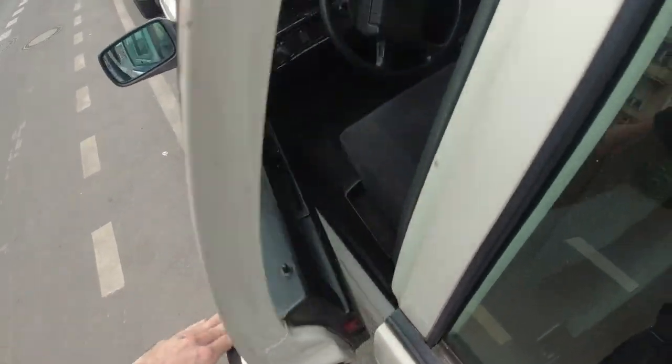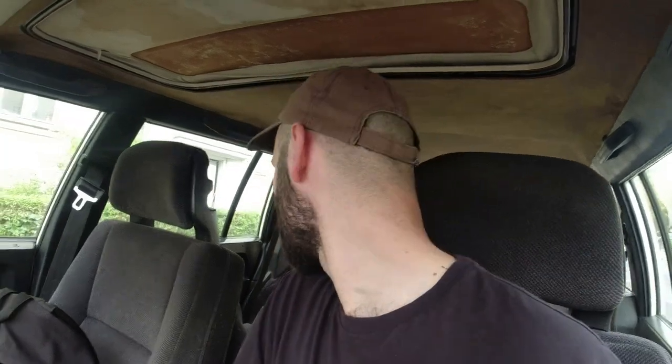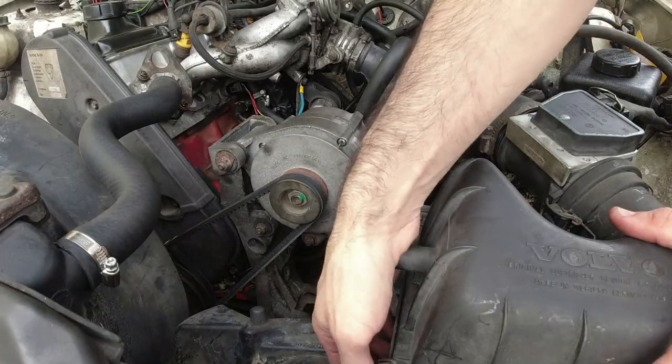Something's really gone wrong there. I don't know what to do now really. What I'll probably do is use some brake cleaner — which I may or may not have — I've got a bit. I'll spray some brake cleaner into the intake and see if we can actually rev it up. Because if it's not getting enough fuel for whatever reason, if we fire some brake cleaner in there and then open up the throttle, the revs will increase.